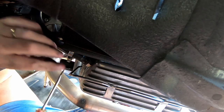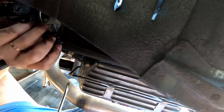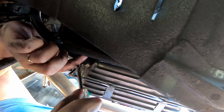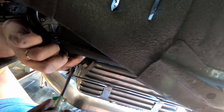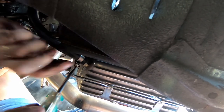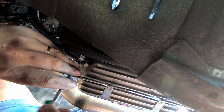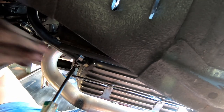So that's lubricating the tappets, isn't it? No, the pressure built up in the tappet covers — it's actually taking the oil out. It's not oil, it's the oil vapor. It's the pressure that the motor builds. Otherwise it pumps the oil out of the dipstick, which you don't want.